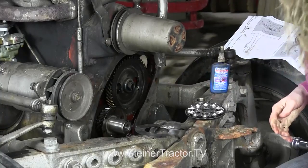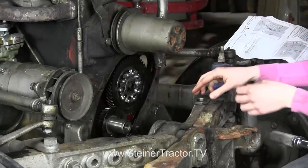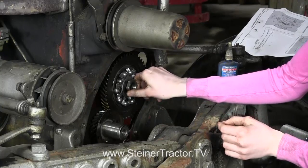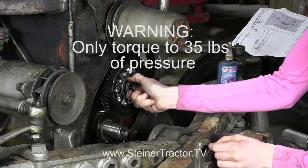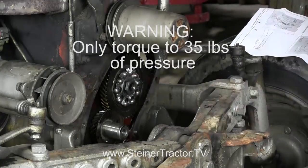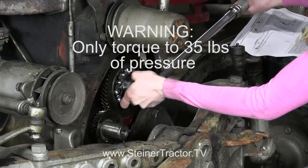Make sure that's completely dry and cleaned up before we put the new nut on. The shim will go on first and then the governor assembly will rest on there. I already put some thread locker on my nut. You'll also notice it's directional — it has a little bit of a groove or a lip and that goes in. This next step is extremely important. At one point there was a misprint in the manual which said to tighten this bolt to 75 pounds of torque. That is incorrect. If you tighten it to 75 pounds you will likely break your camshaft. The correct specification is 35 pounds, so make sure you tighten it to only 35 pounds.